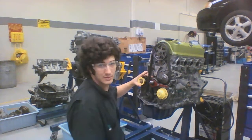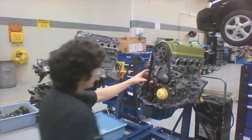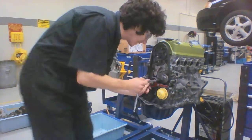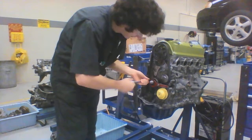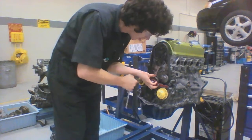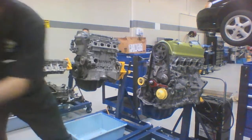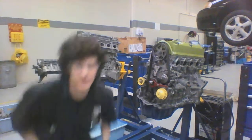As you can see here, we've got a nice action going on, we've got our tension up. What we're going to go ahead and do — since this belt rides on two separate tension spots — you can go ahead and tighten up this initial tension. Make sure, one, you're going the right way, and two, go ahead and tighten up your tension right where you need to be. In this particular scenario, we'd like our timing belt to be a little bit on the tenser side so we have no opportunity of jumping teeth or grinding them. Alright, next let's go with our balance belt.